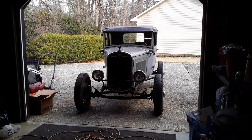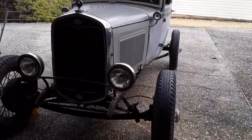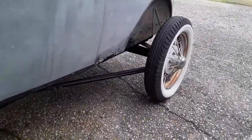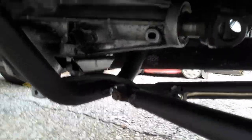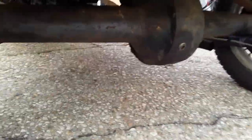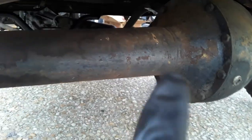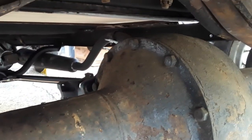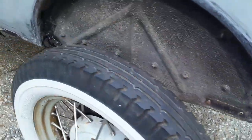Alright, update — it's been since Christmas and done a lot to the car, still in the middle of a T5 conversion. The last time you saw it the arms weren't done, but they are together now — they meet at the crossmember, brake lines are run at least from the back. I need to have a driveshaft made for the open drive, and then connect a third bar from the third member all the way up to the front of the radius arms to replace the torque tube essentially in function.